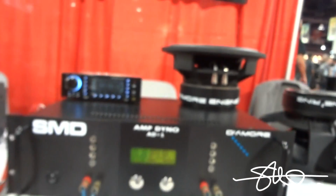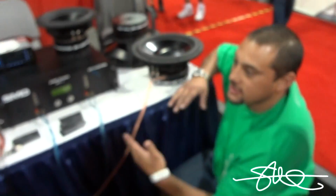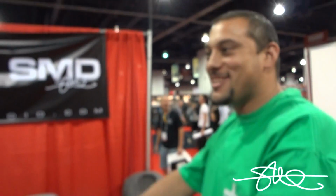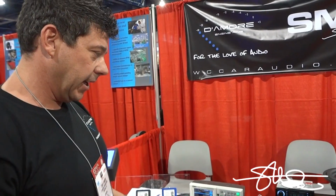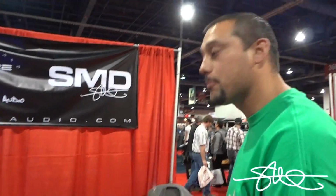That's not a clamp meter going voltage times current. And that's 200 watts RMS, right? Yeah, because it's clean, undistorted, and in phase. This has a non-inductive load bank in it, so the voltage and current are always in phase. You don't have to worry about it. That's the true number, as true as it can be, 100% accurate. And in the car, not on a test bench. You can hook this up to a rack or put it on a dolly and roll it around the shop to work in your car, and it would tell you 100%.